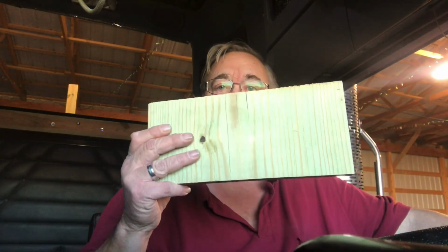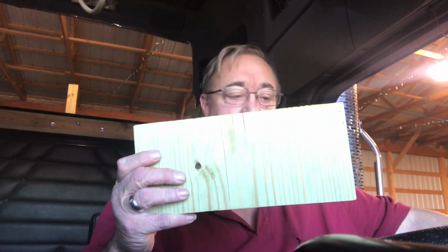Now we're shoring up the corners. Like I said before, the entire upper bunk system was just held in by these two corner brackets, and that's it. I'm going all along the back with those 3 bolts that were already threaded into the wall, plus these other 4 bolts going all the way through the boards on both sides of the wall. Plus I'll do the corner brackets. I'll use my miter saw to do an angled cut because there is a 45-degree metal angle back in the corner. I'm going to stack 3 of these up and bolt 2 bolts all the way through those and through the metal bracket down there in the corner, and then screw in from the inside to all 3 of those boards. So yeah, it ain't going to move.